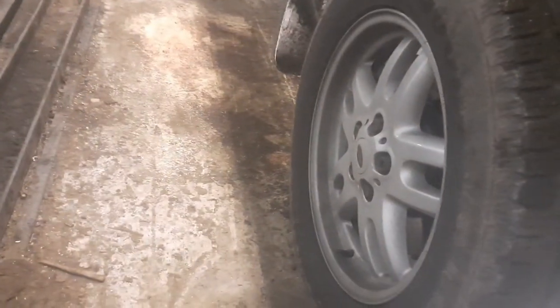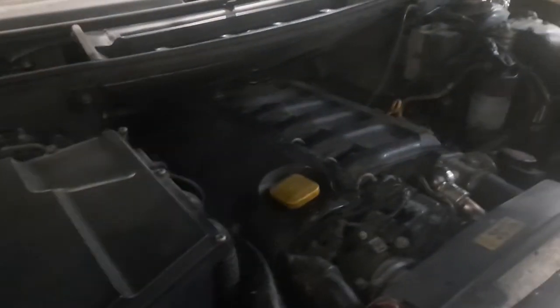So we've got 8 litres in, and we're registering halfway up the dipstick, so I'm just going to fire it up now and let it circulate the oil for a few seconds, then shut it down and top it up again. Let's remove the tools I have, and double check everything. Filter sitting right. Where'd you go?